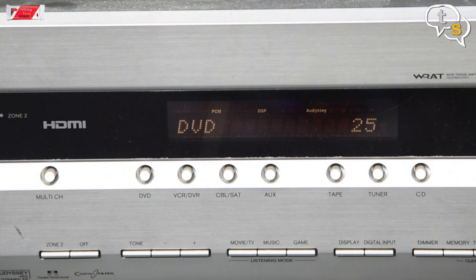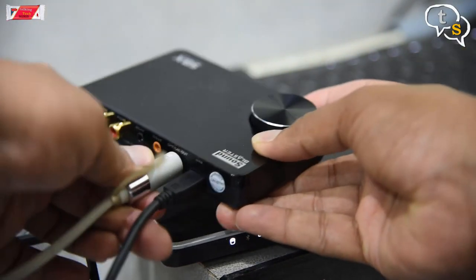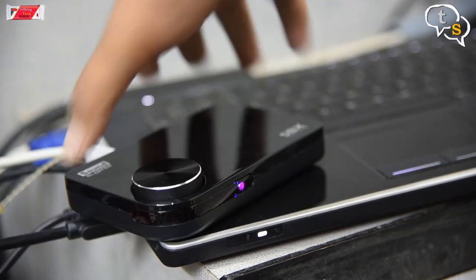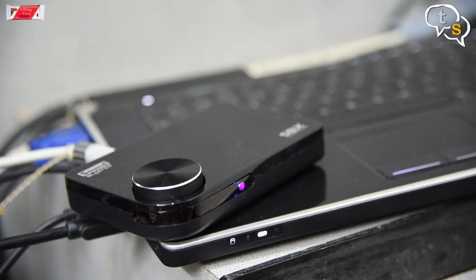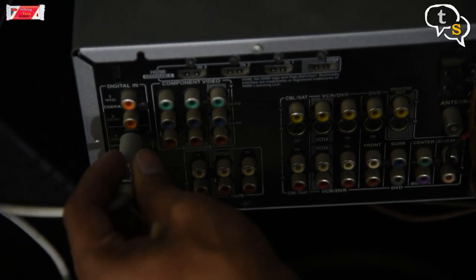As the signal is digital, there is no loss in quality and the amplifier detects the encoded format — decoding is done on the amplifier itself. To set up, first connect the USB cable to the X5 mini USB port, connect the optical cable to the optical out, and check if the light is on in front of the device — you are done on the system side. Now on the amplifier, connect the optical cable and the connection is complete.